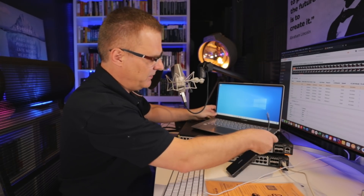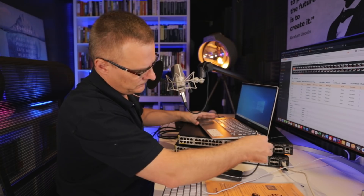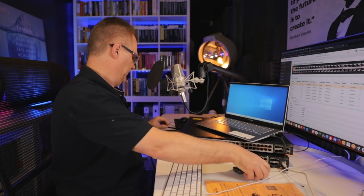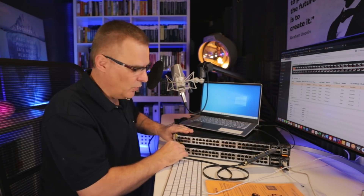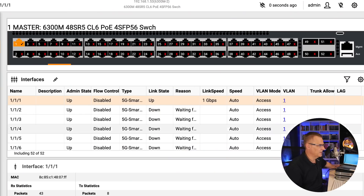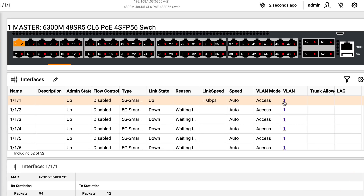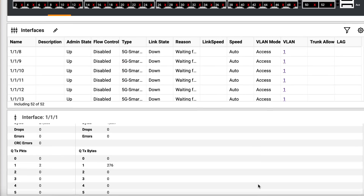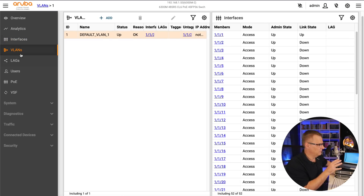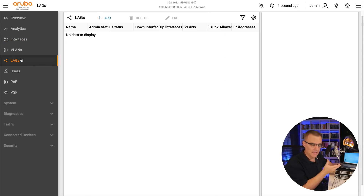Here's a laptop — I'll connect this adapter and plug an ethernet cable into port one on the switch. And what you'll see now is the port is up, speed is one gigabit per second. I can see the VLAN the device belongs to and interface information about the ports. I can configure the switch through this interface — VLANs, link aggregation, and more.